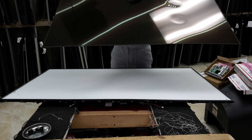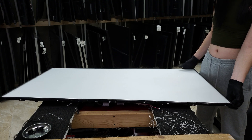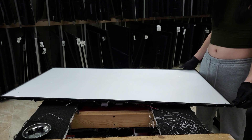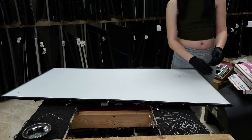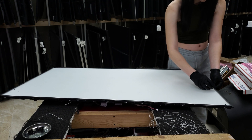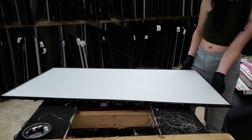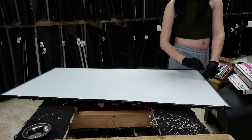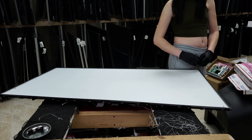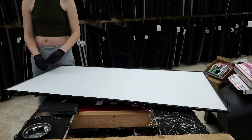See how on the edge there's kind of some flakes, and there's really just like a continuous band that we have to peel off. This TV is just, with the adhesive, a real pain. If anyone has a better method to remove the panel, let me know. But in my experience, I've only been able to get good results with the floss method. It does just take longer than your average backlight repair. Of course, you don't want any of this residue on the panel or on the diffuser.